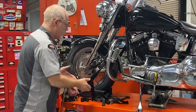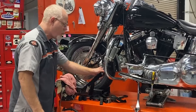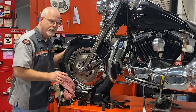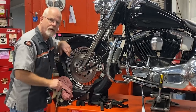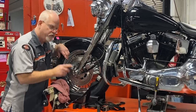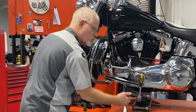Now in lifting this, what I do is undo the strap just a little bit on both sides. Remember, you have one on both sides. I had a young technician once who would undo one side, go up and up, and forgot he had it on the other side. Got to remember — both sides. Just give a little bit of slack, then put your jack in.